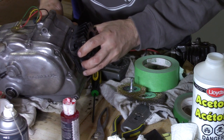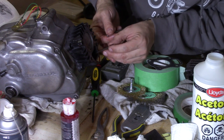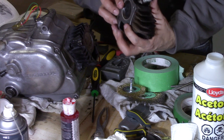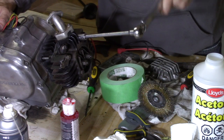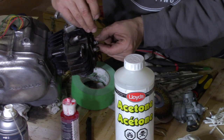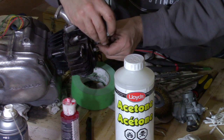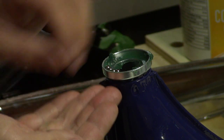This moped hasn't run in about 30 years, so an engine rebuild was a necessity. Unfortunately, but luckily, the engine wasn't seized, and with the cylinder walls rebored and a new ring kit it actually went together quite nicely, and the compression numbers were pretty decent.